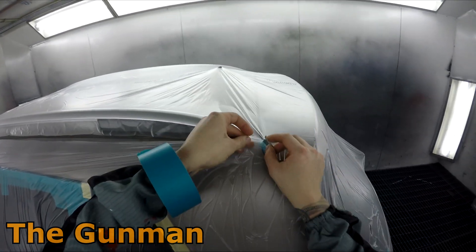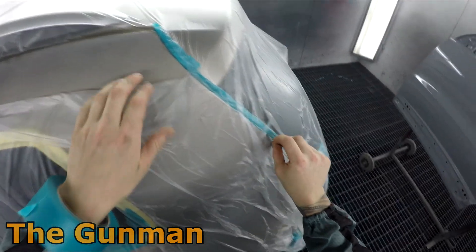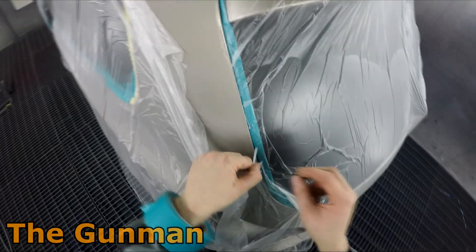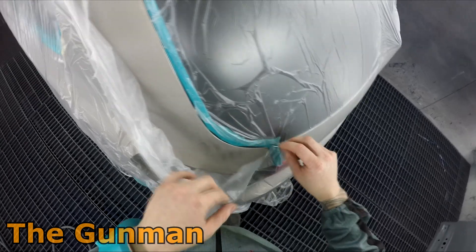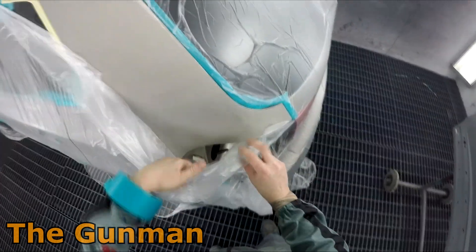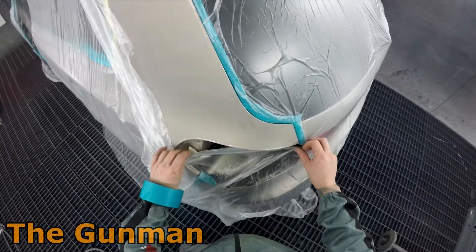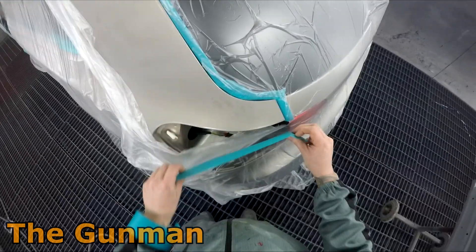I thought I'd include a little bit of the masking stage, just cutting around all the edges with a nice sharp razor blade, making sure that there is no tape sitting on the exterior panel that I need to paint. Some people go a little bit overboard with these edges. I believe all you need to do is back mask - I've flipped that back over on itself, left a little gap there, and that's usually enough.